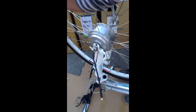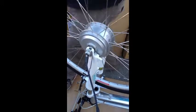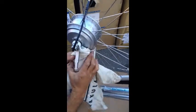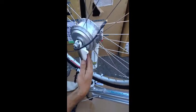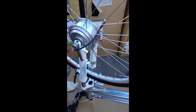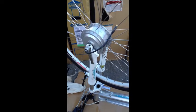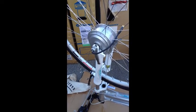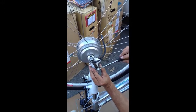The next thing is to give it a reasonably good tighten with the spanners. I like to tighten up with two on both sides so I can put equal pressure and don't start spinning the wheel in the fork itself. I tighten it up reasonably tightly. The next part is to bend the torque bar to the shape of the fork — just protect the bicycle a little bit, then with the hammer put some subtle little touches. You can see the torque bar has now taken the shape of the fork. It just needs to stop the motion in that direction. As the wheel puts torque that way, it's an equal opposite force there. Finally, just to seal it up, use a hose clamp around this point and tighten that up nice and securely.